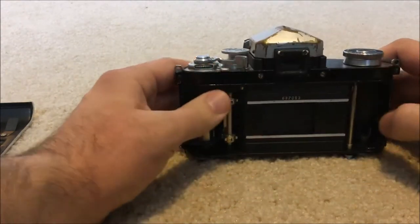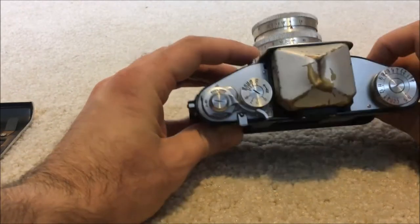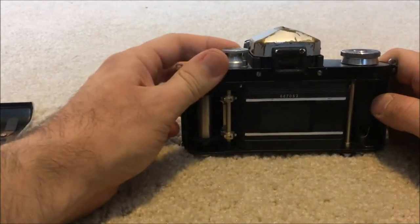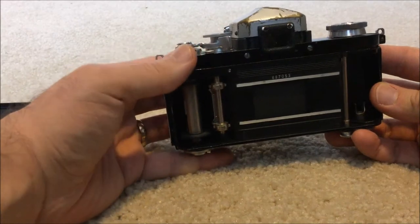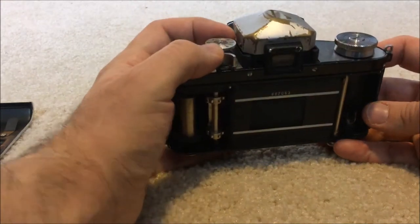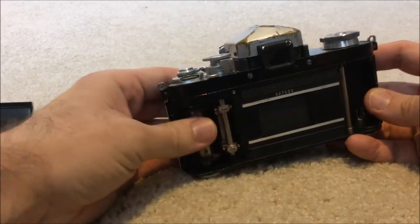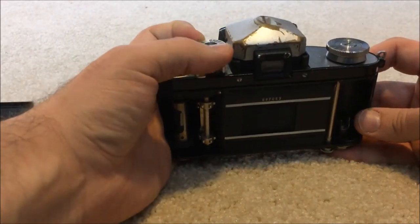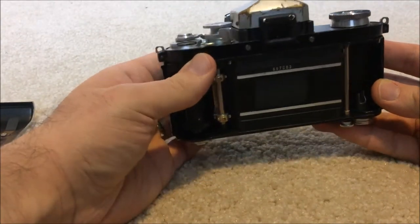So I just cranked it, and to take a photo I press down on the shutter button on the front of the camera — it takes a little getting used to. You'll notice that it takes a photo. The mechanism is a little different; it's a curtain shutter. So you'll notice when I wound it and press it, the curtain goes by really quickly. If I do it at a slower speed, say one one-hundredth of a second, you'll notice the curtain move to the next slide. At one one-fiftieth of a second, you can watch it go across — you can really see the curtain movement.